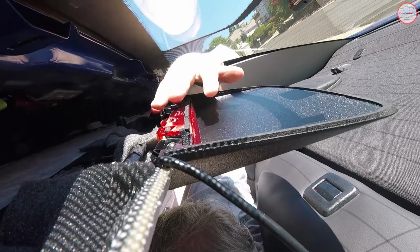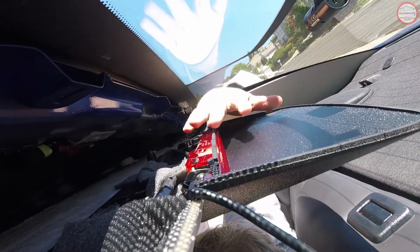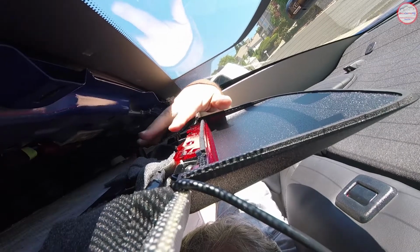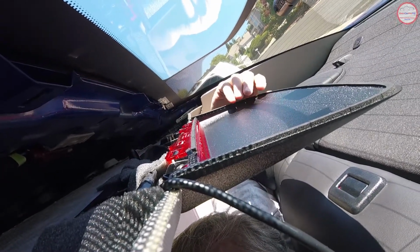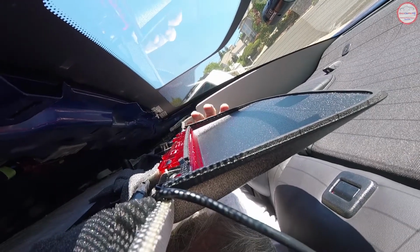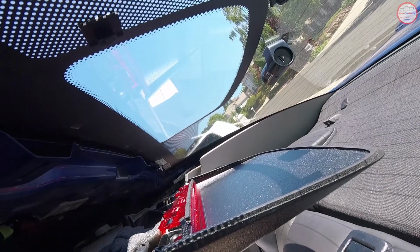So again, you'd want to make sure once you got the third brake light and all the screws in place, because you tend to hit the glass as you're doing that, one, that it's clean still, and then two, that you haven't taken the foam piece and somehow brushed it with your arm and then rolled it off, or the glue didn't stick or something to keep it in place. So before you get beyond this point, check again, clean again if necessary the window, just to make sure no arm oil or fingerprints or anything are left up there.